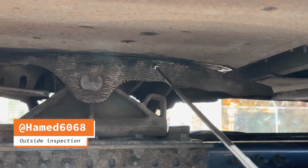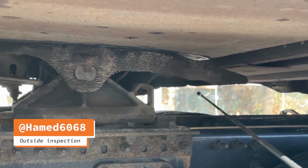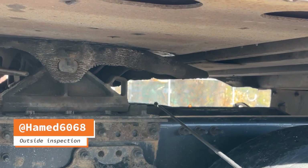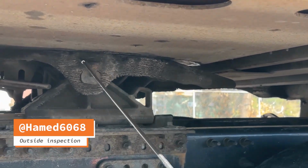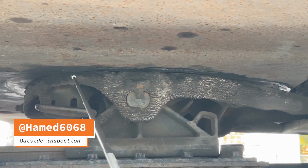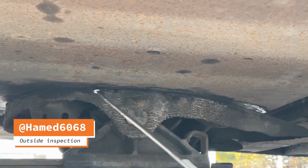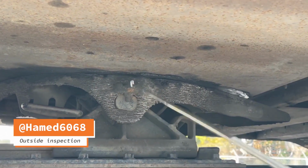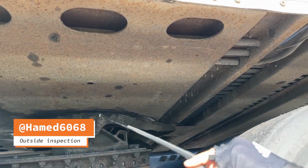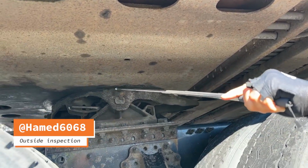Skid plate securely mounted to the platform base, not broken, cracked, damaged, no loose or missing nuts and bolts, not excessive wear. No gap or no space between skid plate and apron. They are properly greased. The apron is not bent, broken, cracked, and is lying flat on the skid plate.